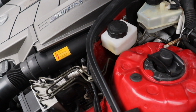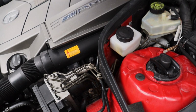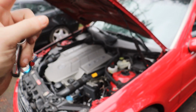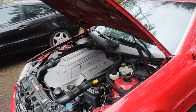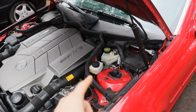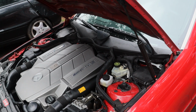So I'm just gonna try to pull from the top right now and see, while the fluid's warm, if it changed anything. Other than that, the only thing I can think of at this point is to hook up that remote bleed line and get a proper vacuum pull from the throw out or slave cylinder. So see what I can pull from here, if anything, and if nothing there, then my only method is going to be pulling from the bottom at this point.